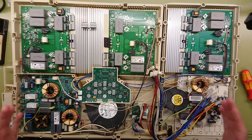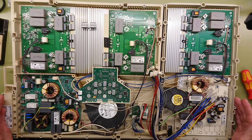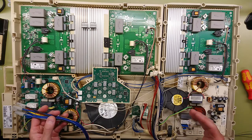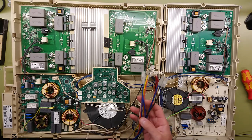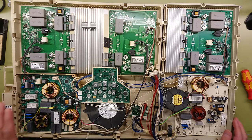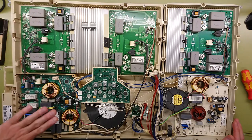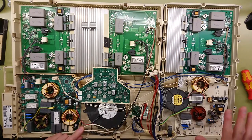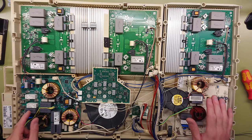Let's get the metal shield removed to see the PCBs. The entire inside of this induction cooker is made up of all these boards — both disappointing and a bit interesting. It is a three-phase setup, so that's three times 400 volts, or three times 230 volt AC referenced to neutral. The input power board has two sections, each fed from one phase plus neutral at 230 volt AC.